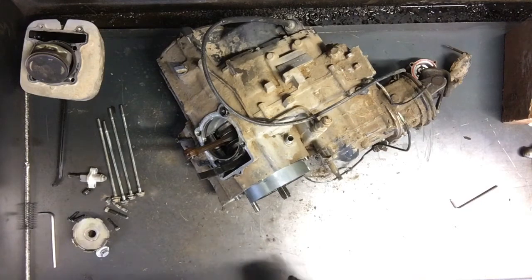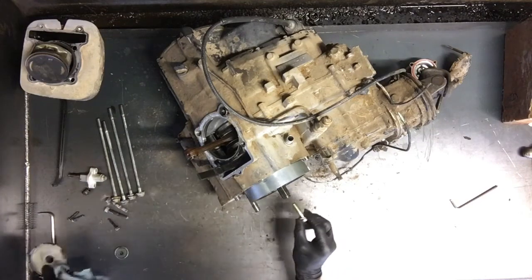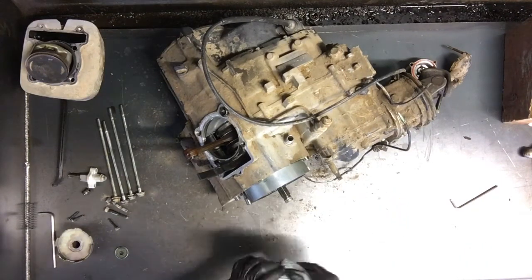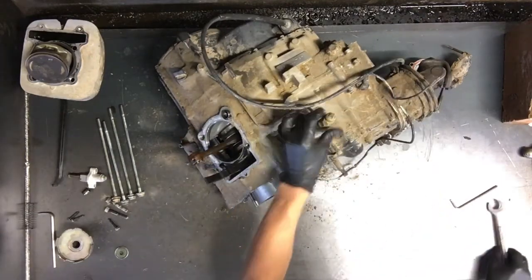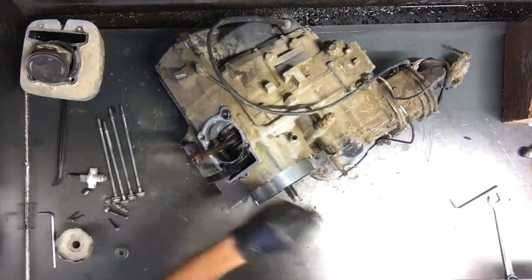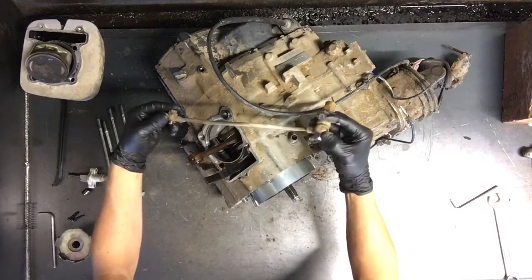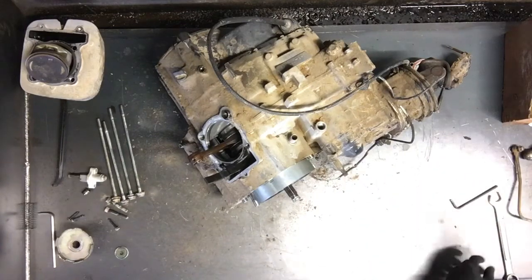Now what I'm going to do is put this bolt that was with your recoil starter cup back in here — I'll show you why I do that here in a second. We'll pull the oil line off now with the oil sensor. 19mm and then you've got a 12mm on this side. I'm going to keep these together. Brass washers on either side of these oil lines — so make sure going back together that those go back in there. You don't want to reuse those either — those work as a gasket and they seal up.